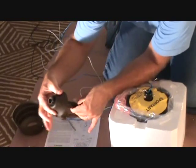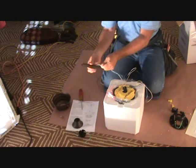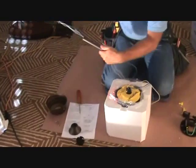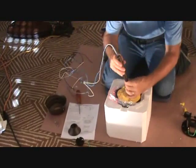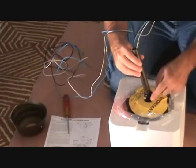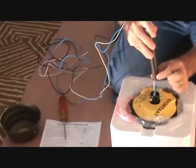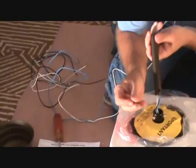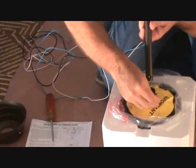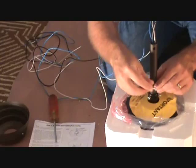Leave the housing off for the moment. Now take your wire and slide it all the way down on here. I've got the wire so I'm just going to slip that in there - they push right through nice and easy. Without that knuckle on there you don't have to worry. We're going to pull that all the way on here and position it down. Loosen up those screws to make sure you can push this all the way down. Now push your wires down, line it up, and gently fish the cotter pin through.